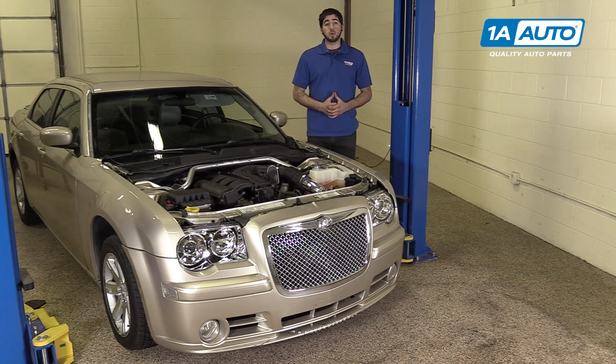In this video, we're going to be working with our 2006 Chrysler 300. We're going to show you how to remove and replace your SCCM or steering column control module. This module is responsible for the operation of things like your airbag, your multifunction or combination switch, cruise control switch, electronic tilt, and anything else in that general area.